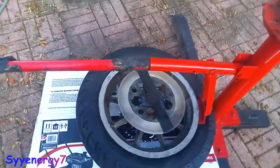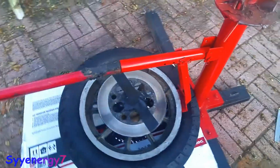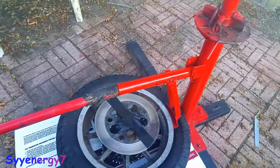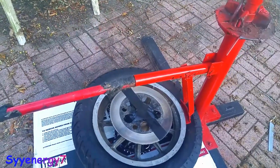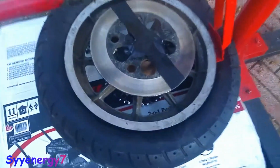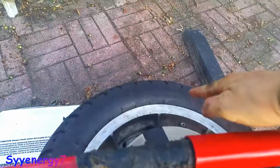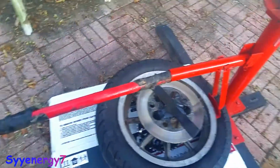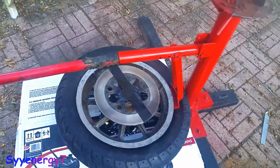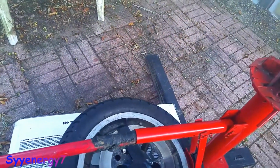So I'll break the rest of the bead on this tire now, and then we'll clean up the rim with a wire brush on a drill or something like a nylon wheel. And you've got a rotation on here. It's got an arrow, so you can see it right there, drive. Put it whichever way the wheel spins. And usually there's a little mark on the tire. That's the low weight. So usually you want to put that about where the valve stem is.